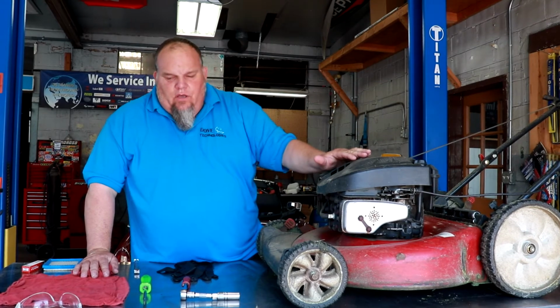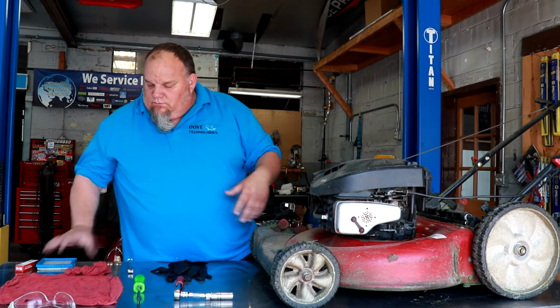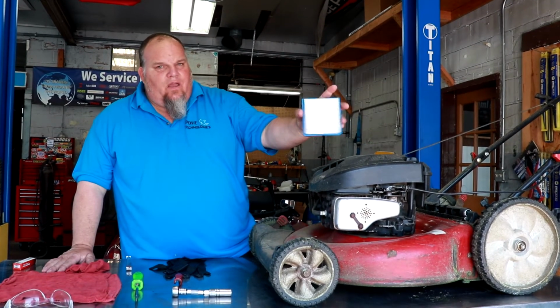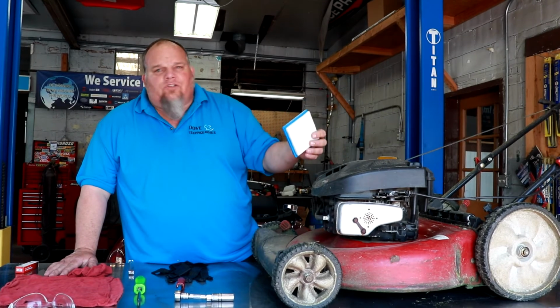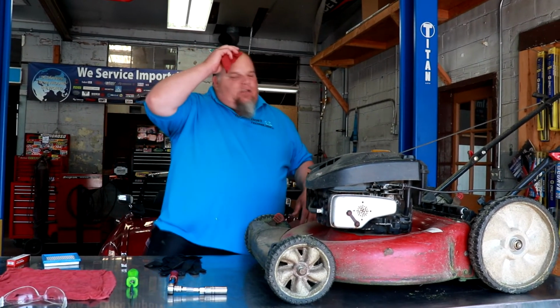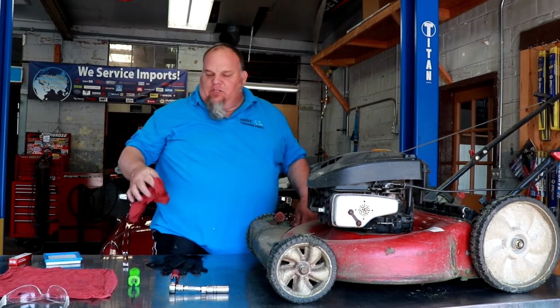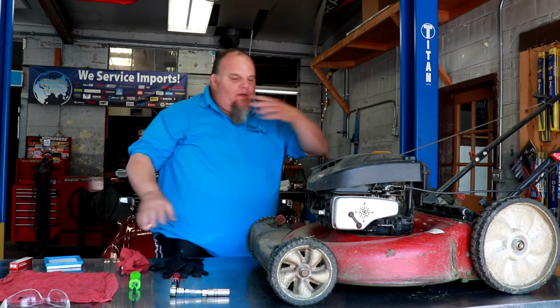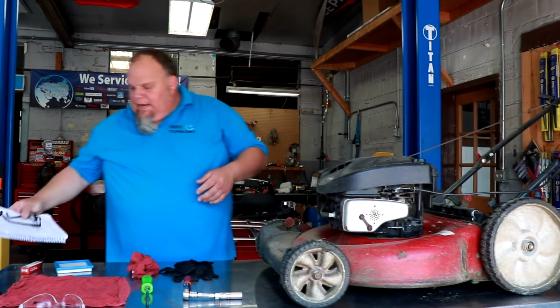Your air filter comes off, just take the screw off the side of it, take the air filter out. Most of them look like this one here. It's just a small paper element. Put your new one in, pop it back on, one screw, it's back in there. I mean, literally, people, if I'm talking about changing the oil too, you're talking about maybe 20 minutes worth of work. That's how quick this goes. Now, I'm about to show you something that happens.